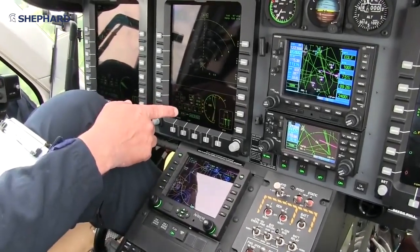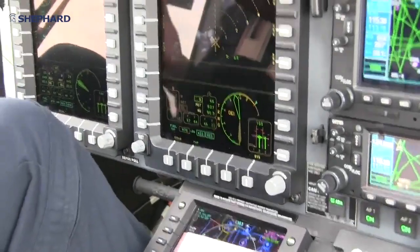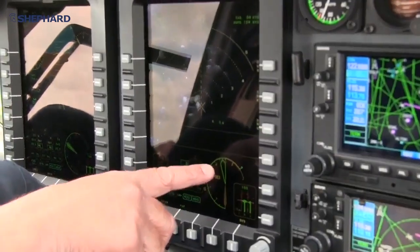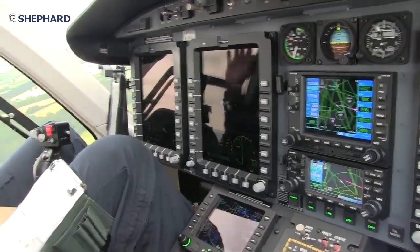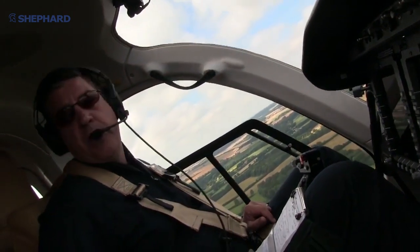The autopilot system, the transmission — I'm still managing, sitting here at 900 feet. I'm still in the green on my power setting. It went into the yellow but came right back down into the green. RPM dropped by 1% but came right back up. I have not put my hands or feet on the controls, and we're basically in single engine operation right now.